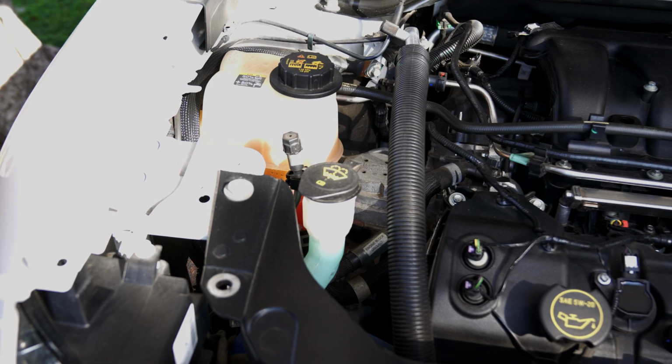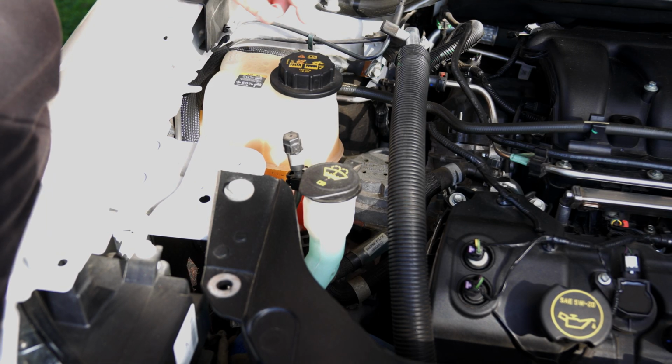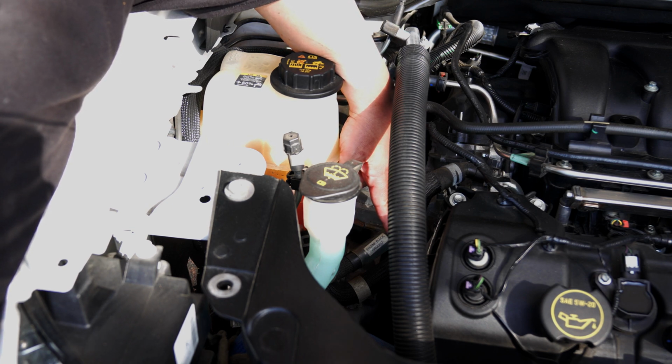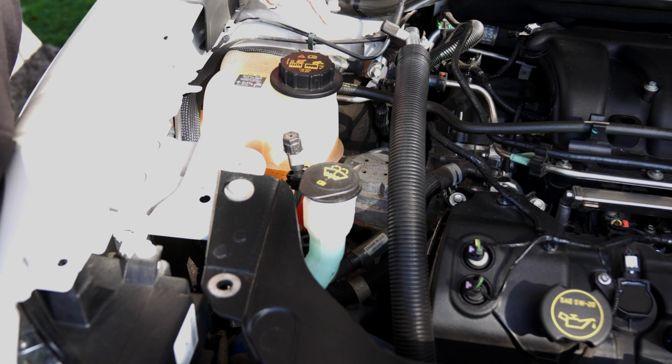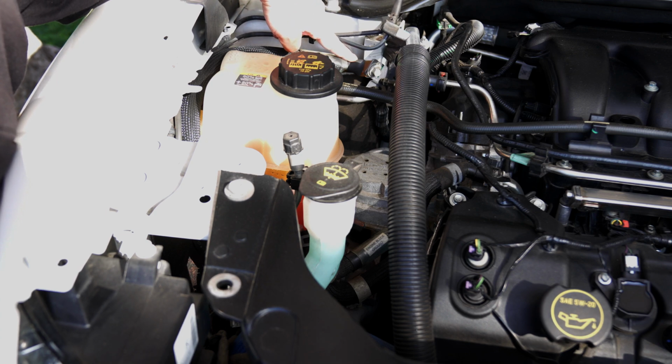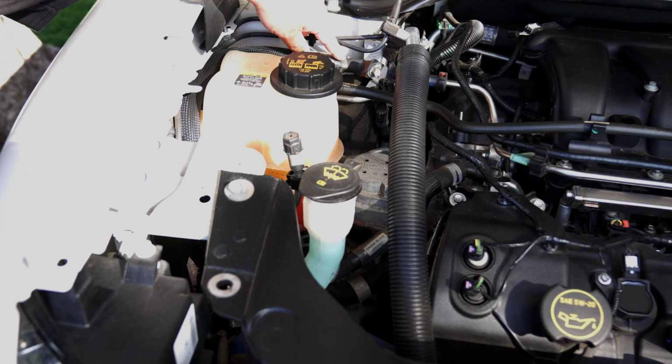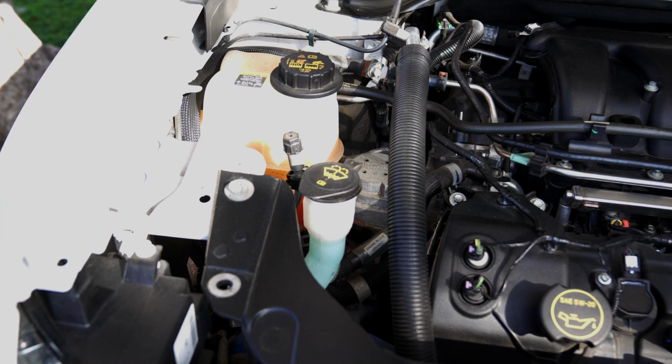Right here, this is my third ground point, which makes it the big 4. You can see the cable here. I have this connected to the engine block, and from the engine block to the last point that I have here of a stock ground location. I'm not really sure where this leads to be honest, but I went ahead and did that extra since that's all I can find within the engine bay. But it's been doing really good. I haven't been having any ground issues. Everything's been working great. So now that I have that done, let's go ahead and show you the fuse side.